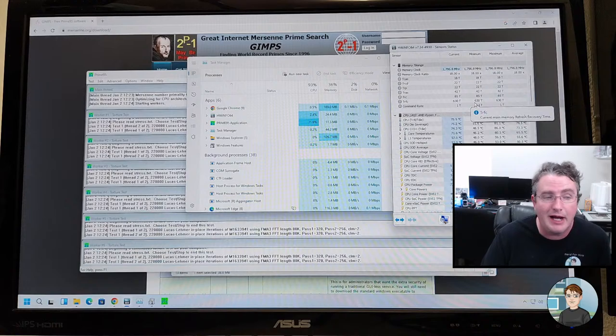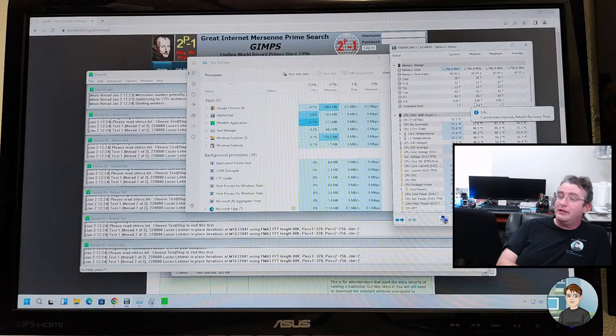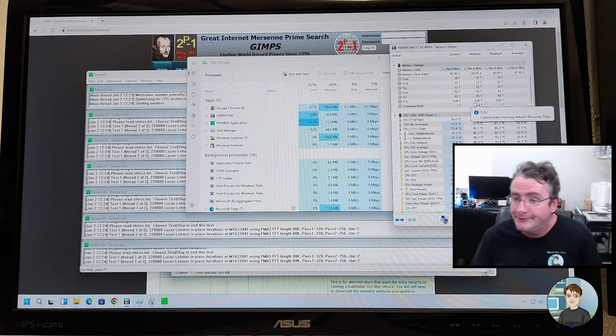The temperature is high. I don't know that it's necessary for them to get a better cooler, like a bigger cooler, like a Noctua or a Be Quiet, because whenever you're playing games and just doing stuff, it doesn't fully stress the CPU. So it's going to be well under probably 70 degrees when he's actually using the computer, which is okay.